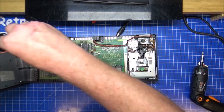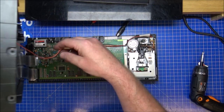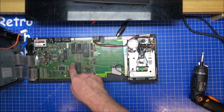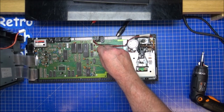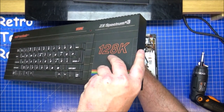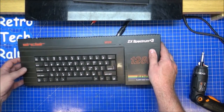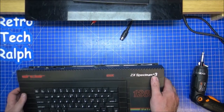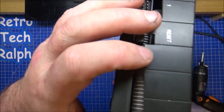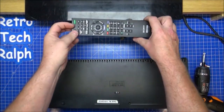Okay, so the final one needs to put in both ribbon cables on here, and the LED, instead of the 5-pin, which would have the tape deck, which would have been here. It was actually over here, but isn't used. So make sure you plug that in as you're going down, the right way around. Watch out for the ribbon cable sticking out or being trapped. It's very close to there, but it's just been pushed around by there.